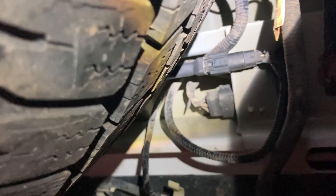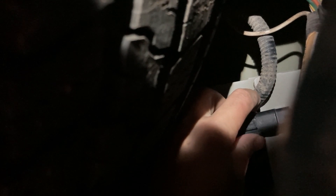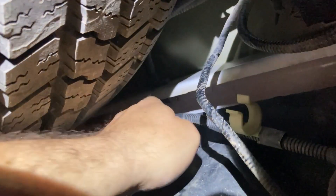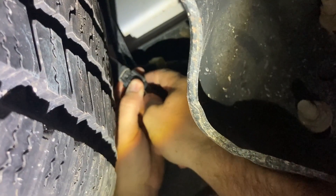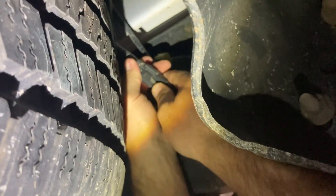We'll show you how to do that. You want to put a screwdriver right in here to depress that clip, and while you're doing that you pull apart both sides. We'll show you that in a minute once we don't have the camera here — we'll show you how that comes apart. Once you've got that clip off, you'll feed it through back through the tailgate before you take it off. Get up in there and hold that clip down and then it will pull apart.